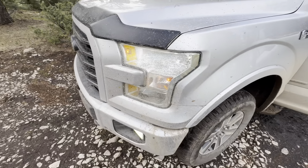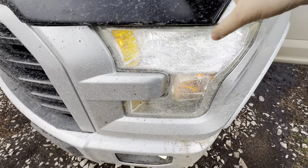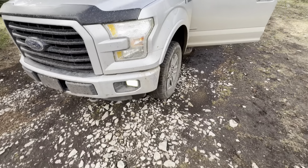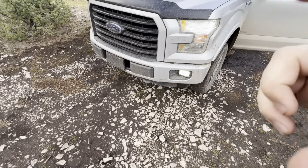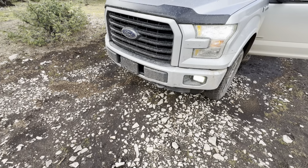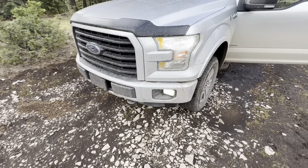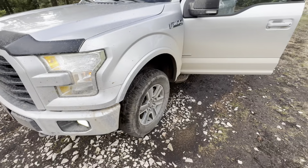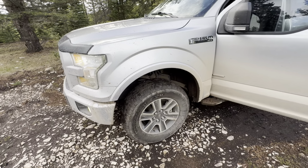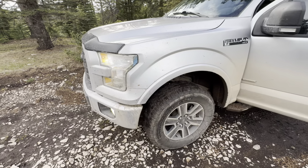But if you are going to go with the LEDs, I have one big piece of advice for you, and they're going to be linked in the description as well: the covers that go on the back of your headlights need to be extended, because the LED cooling fan extends past the factory spec housing just a little bit.